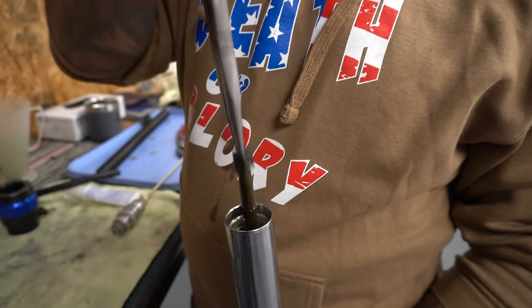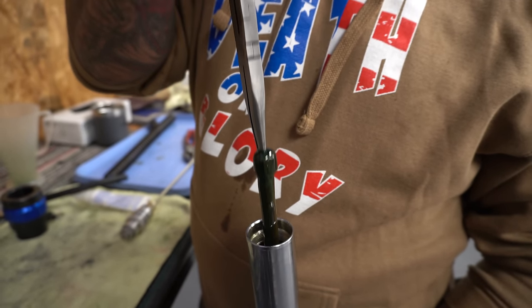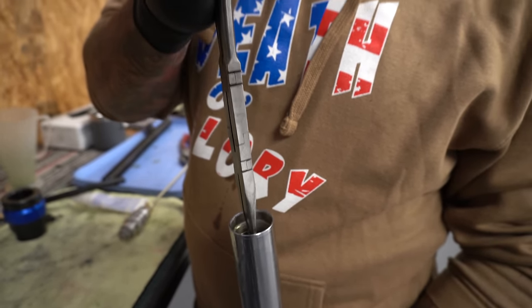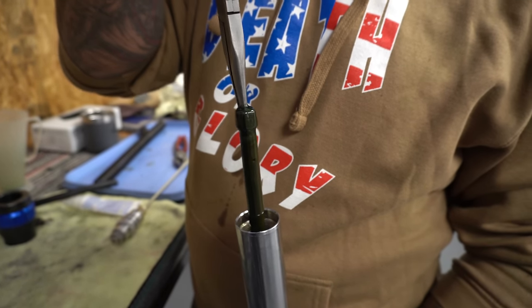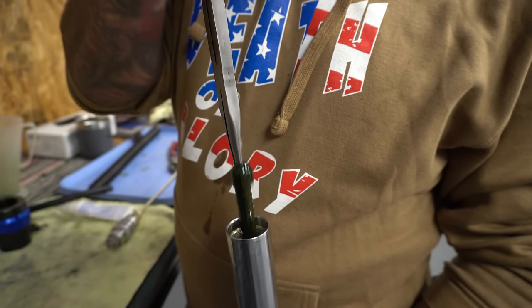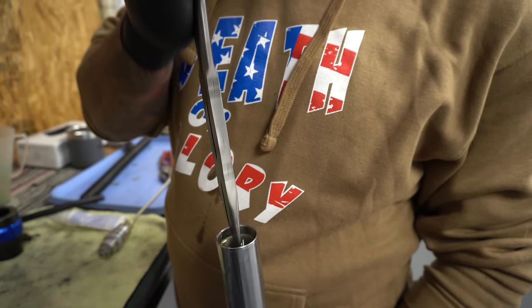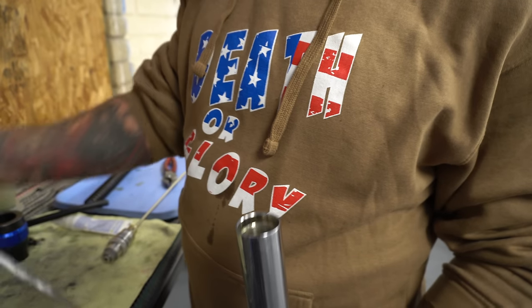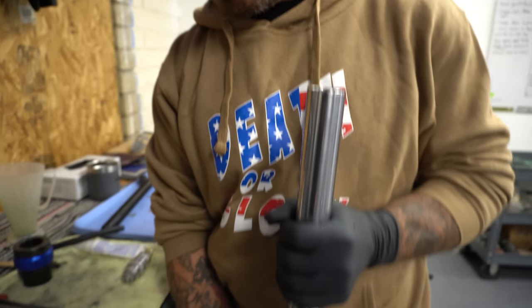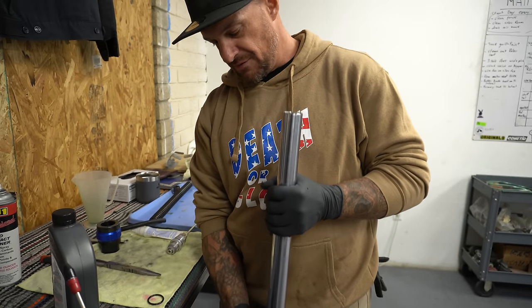Starting to get some resistance. See the fluid come out of the top of the tube there? You want to do it till you got a steady flow of fluid out of the top. Pop some air bubbles, get them all out of there. See, they're still blurping. Right now I'm gonna do the same thing again with the tube. Let's get rid of as much air as possible.